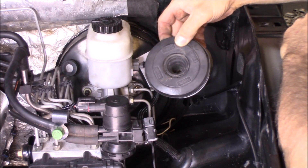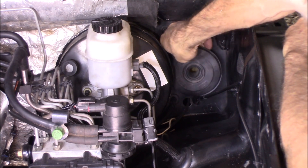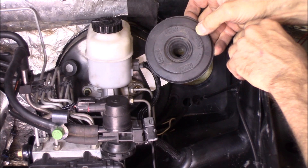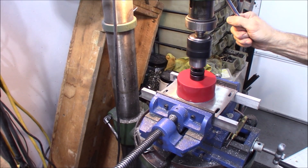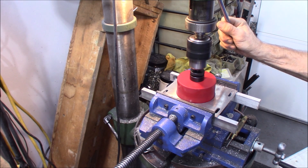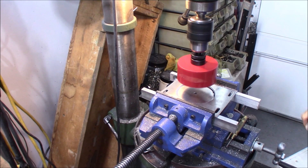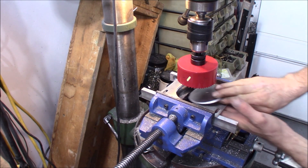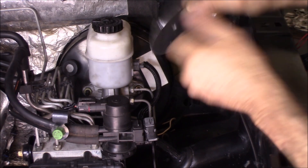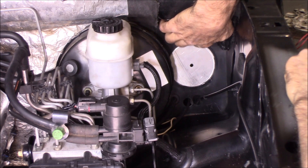One of the things I want to take care of — I took the grommet out where the wires pass through. I didn't really want that there; it isn't totally unattractive but I don't like it. Using a 3-3/4 inch hole saw and a 1/8 inch thick piece of aluminum, I'm not trying to cut all the way through — I want to leave a lip on there. That lip is going to catch the edge of the hole that we're trying to cover up, and then I'll glue it into place. There we go — pop it out. Now with that piece of aluminum cut out with the lip, you can see it fits in there just perfect. Nice and flat.